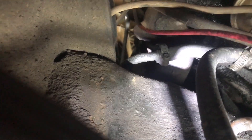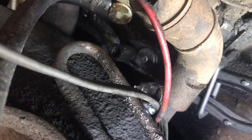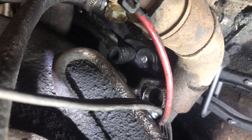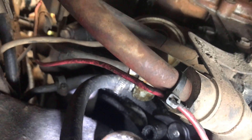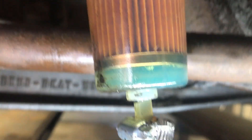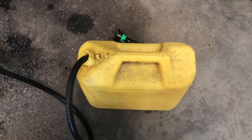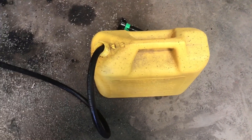Now look at the front of the vehicle — there's a line coming from the fuel tank, it comes down and gets clamped off and disconnected right there so I can run this test. But if you suspect that you've got bad fuel in your tanks, or it could be the lift pump, one way to eliminate it is to just run a line like I've got here from the lift pump down to an inline filter, and then run it down to a gas can or diesel can. It's a diesel can here, full of diesel for this truck.